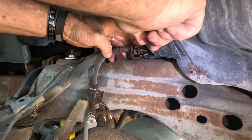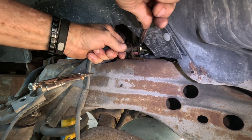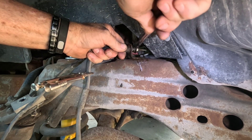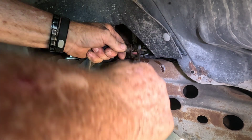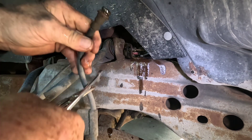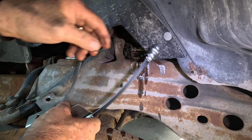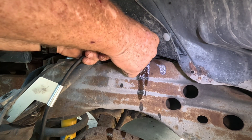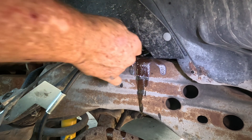At this point make sure you've got plenty of brake fluid in the master cylinder so you don't run it dry while you're taking this apart. The fitting is tight, but we can take that loose, take off my vice grips, and then bring the new hose up here and get that started.